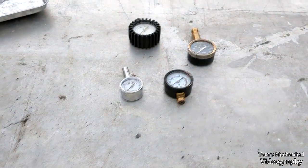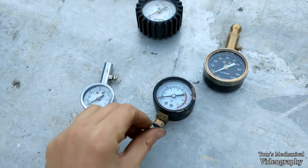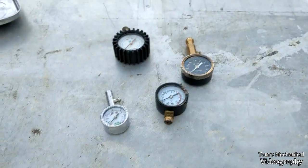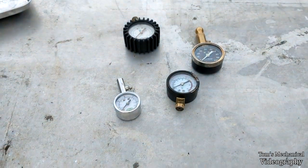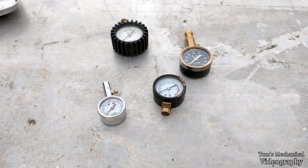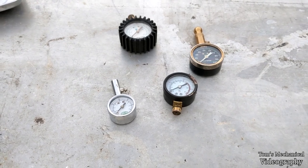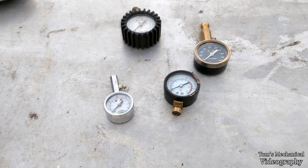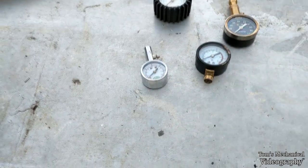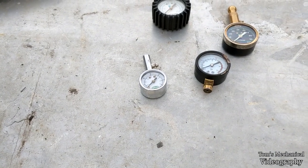Back together. I checked the compressor gauge off-screen just pressed up against my big compressor, and it's reading pretty close — within 5 psi. It seems to be the same at 80 psi, which is kind of the mean operating range for that gauge anyway. At 40 psi it's reading about 5 high, but I'd rather read a little bit high than low — I don't want to accidentally think my tank is much lower than it actually is. And this Slime gauge is now perfectly accurate at 40 psi, so I'm going to hook it in the truck.